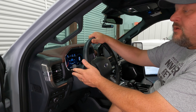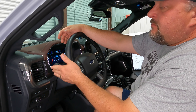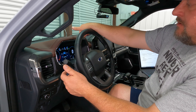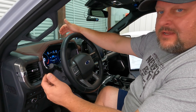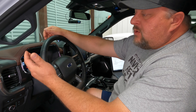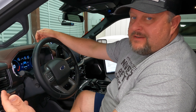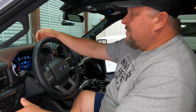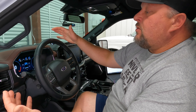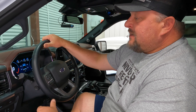Another feature that is already available on the spreadsheet is the ability to change your blinker - meaning how many times it blinks when you soft tap it. Right now it's three times by default. Some people want it to blink once when you tap it, you can do that. Some people want five times, seven times, ten times - whatever your heart's desire, you can have that with FordScan.